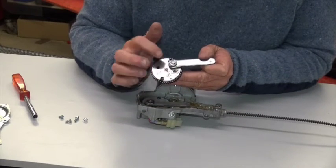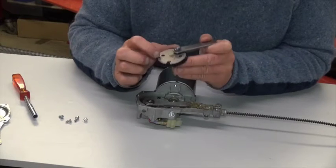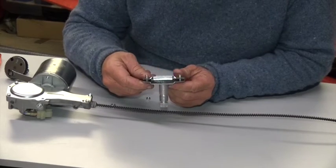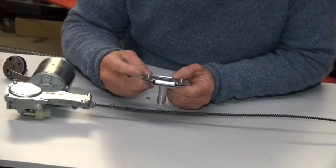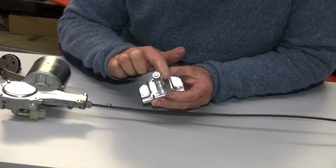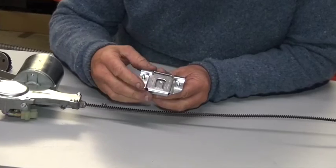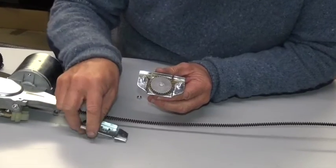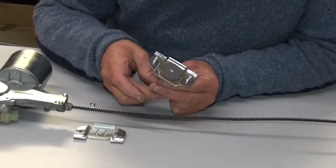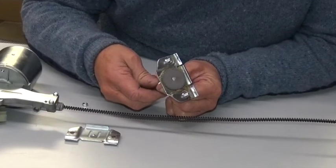Several different sweep angles are available for this gear, and this one is 110 degrees. Here's a wheel box — you'll get two of these with the kit. This is the part that comes up through the scuttle. If I take the back plate off, you can see in there there's a gear wheel. If I rotate the spindle, the gear wheel turns.